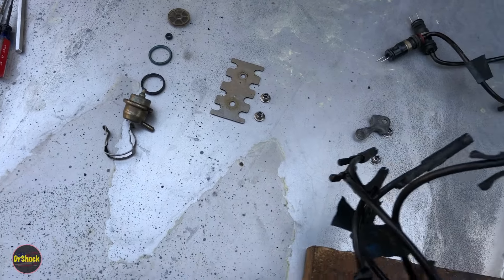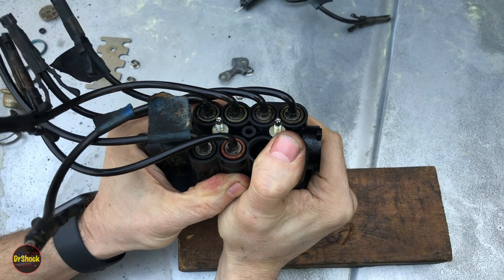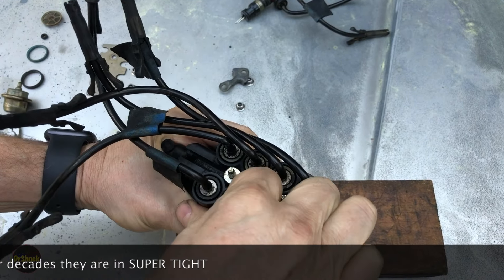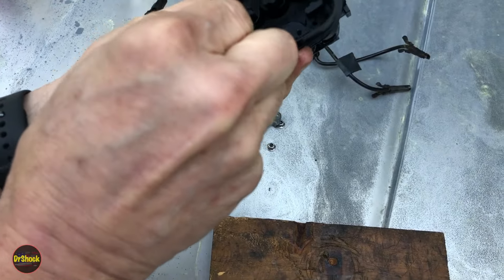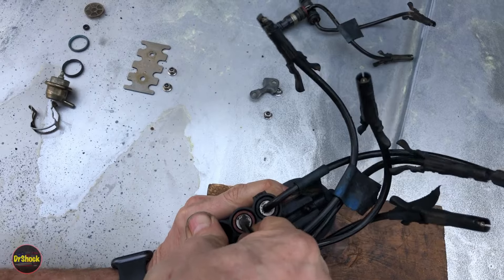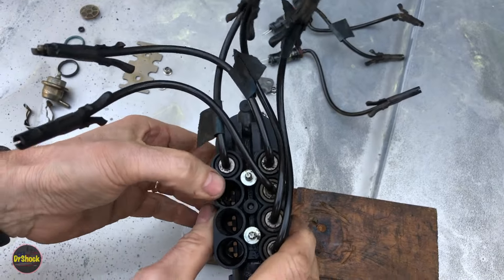What I like to do is grab a piece of wood, position the screwdriver in that hole on the next injector, and just push down on it — you can see it starts to move up. Once it starts moving a little bit, you can get on it while pulling down and also pull up at the same time. They can be very tight after this many decades, but they will come out. That's how you get all of these out. I'll go ahead and remove them all the same way so we can get in here and clean up the body.